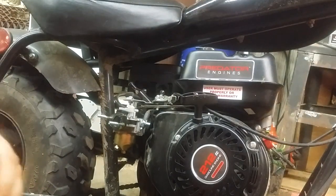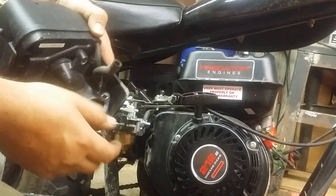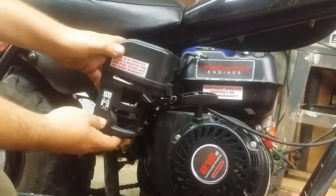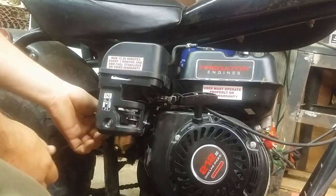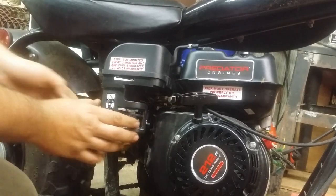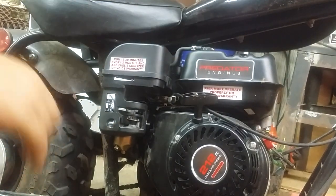Now we're going to get our air box right here. Make sure there's no trash in the bottom here so it doesn't suck it back into the carburetor. You just spent so much time cleaning. We're going to line the holes up on that. Both holes, preferably. As you're doing so, you can feel the hose. You can't necessarily see it, for the valve cover. Thread that back on there. Just give it a little wiggle. Push this all the way flat. Put the little breather hose for the fuel tank back on.